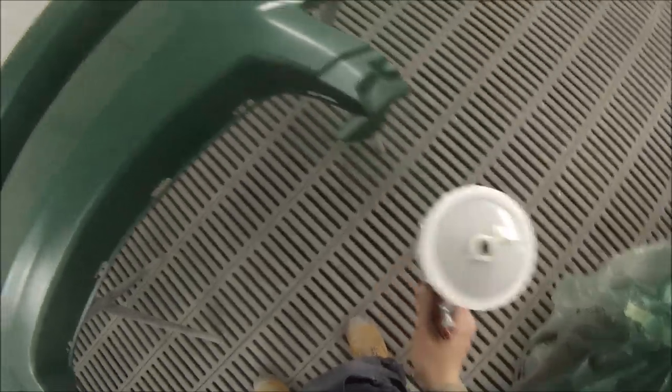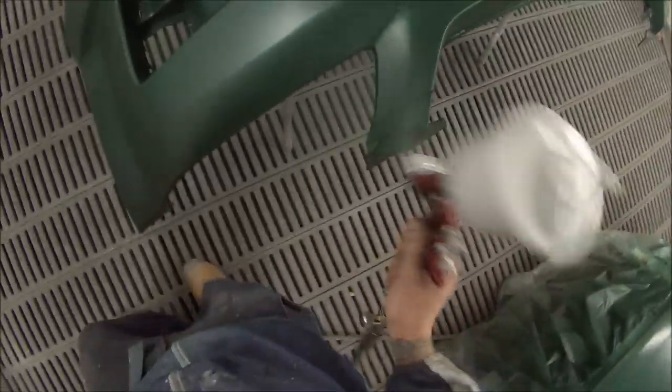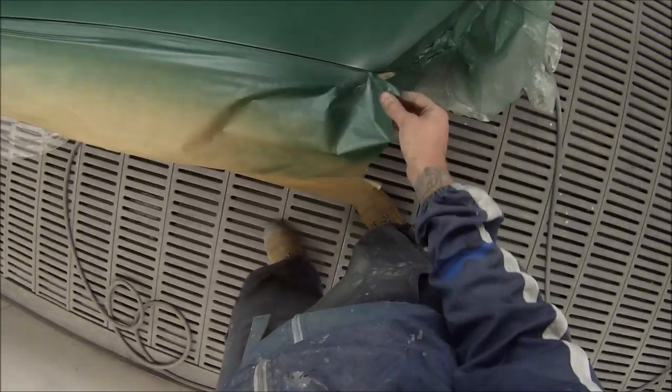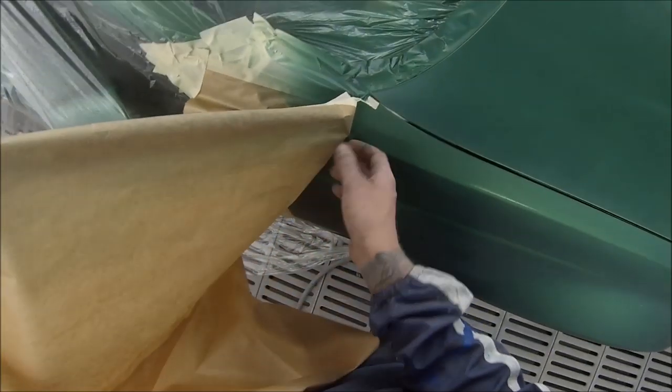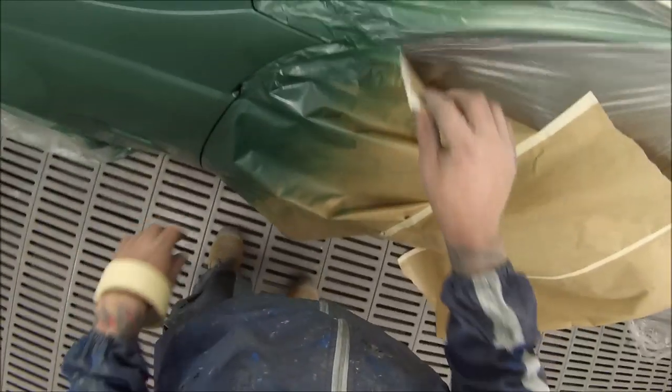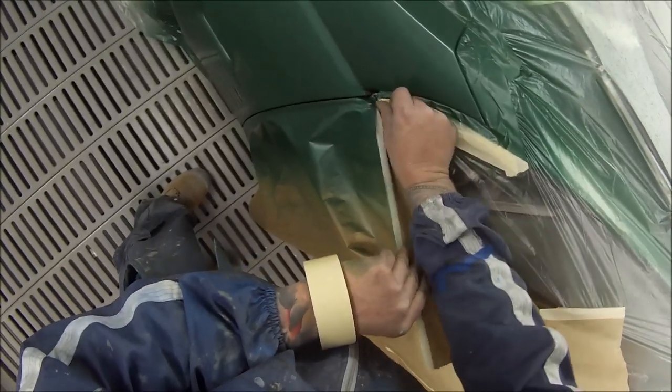The second coat over the bumper bar is pretty important to get it over the black bumper bar, because you see some guys get the bars outside and it's just black compared to the car — they've painted the whole front end and the bar too, but haven't got coverage over the black bumper. Now I'm unmasking that. It's not the perfect colour, but it was just a bit of blue with a touch of yellow — got it somewhere half close. Now we've got basic coverage before we even put our top coat colour on. It uses up some old paint and saves the boss a couple of dollars.